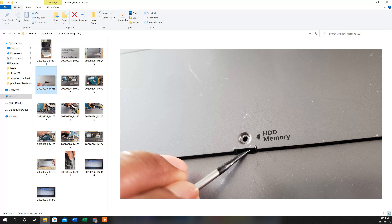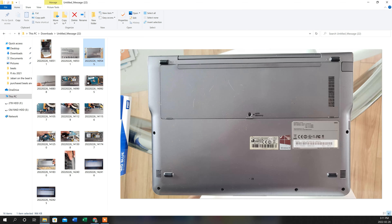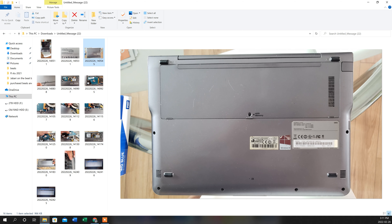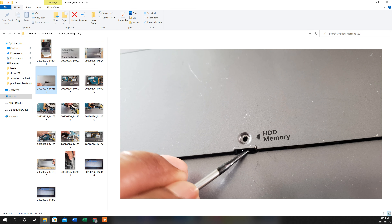With this model I actually had to use a flat screwdriver and place it in the center part where the screw is. You'll need some type of strong pick tool — I used a micro flat screwdriver placed under there. I lifted it up and it started raising, but the left and right tabs wouldn't release, so I had to jam the pick tool in at a slight angle to lift them, as there's a clamp holding them down. Once you wiggle around with it a couple of times you will get it open.